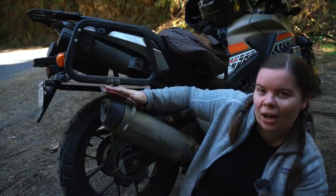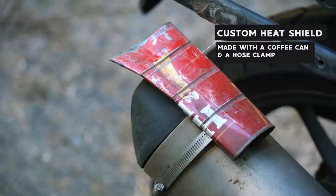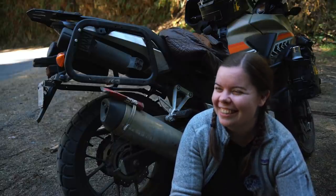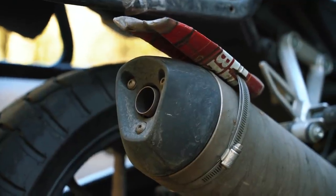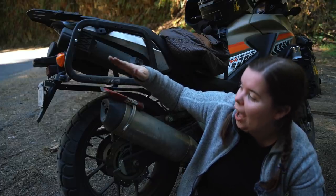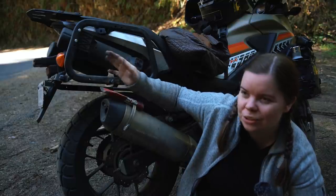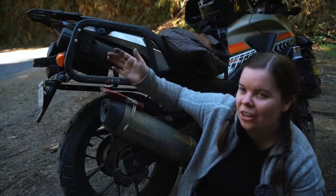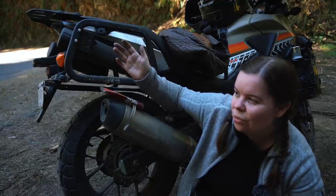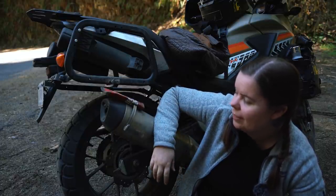Last is my custom heat shield that my dad and I made out of a coffee can after the whole explosion incident — it was a literal catalyst. It does its job to make sure that my saddlebag can no longer sit straight on the exhaust. The way that we folded it under and over itself, I can put my hand flat on it even when the exhaust is hot. There are actual heat shields you can buy, but this was a creation out of necessity because I needed it for the ride back to Portland and I just haven't seen a reason to upgrade it. We did sand down the back edge and cover it in tape so it wouldn't cut into my saddlebag.